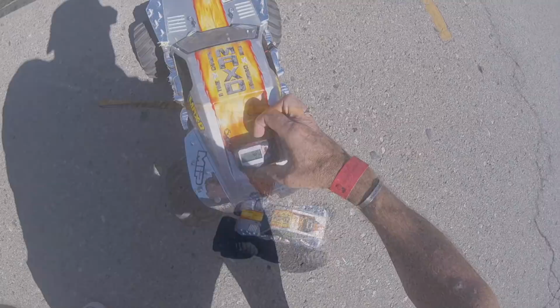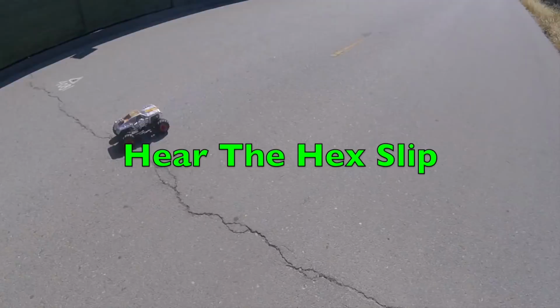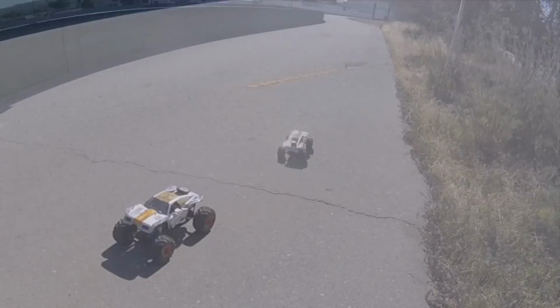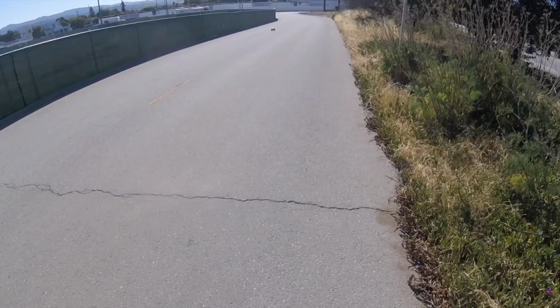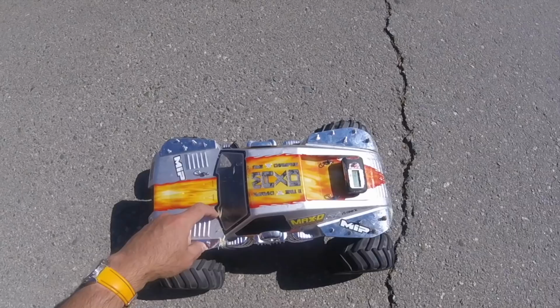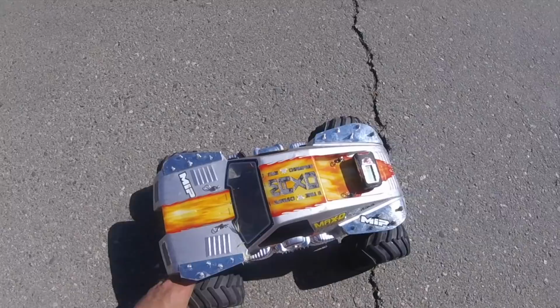Miles an hour before it went airborne. Ooh, and I got some major steering issues. Something is amiss in the steering. Joys of speed running, it doesn't always go right, so it sounds like something else may have come adrift on here. I'm expecting it may be one of the wheels actually, but I need to tighten that front steering up because that's not acceptable with being that loose.